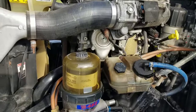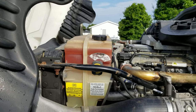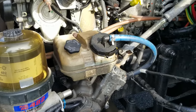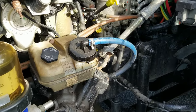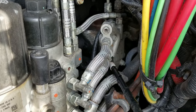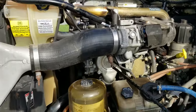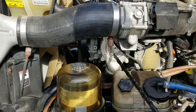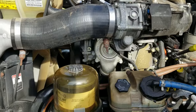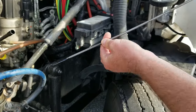On the left side of the engine, the first thing I want to check is my coolant level to make sure it is between add and full. I will check my power steering fluid to make sure it's between add and full. I'll check my power steering hoses to make sure there's no damage, no leaks. I'll check my air compressor to make sure it is securely mounted, no loose or missing bolts, no signs of leaks. I'll check my water pump to make sure it is securely mounted, no loose or missing bolts, no signs of leaks, and it is belt driven. I will check my oil level, make sure it is between add and full.